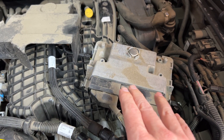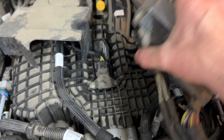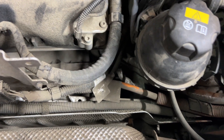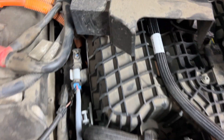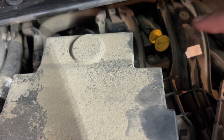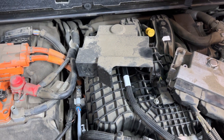I already took these connectors off — the pins look fine, there's no corrosion on them. So I don't think the water damage is the issue, but I also see some evidence of rodent activity in here. There's a little cover for the control unit and these marks here — they're little mouse feet. So there could be some rodent damage in the wiring harness somewhere — it's possible.